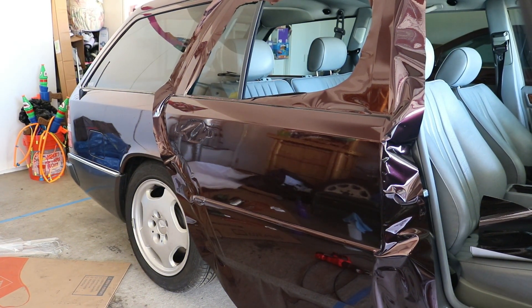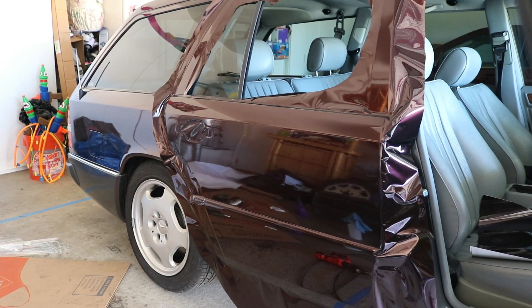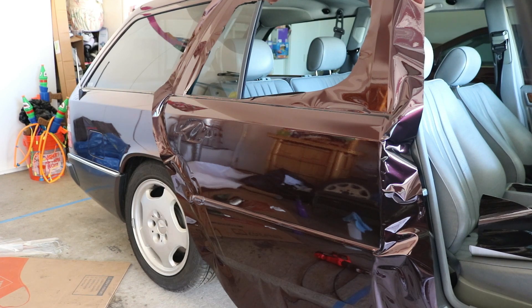I would say this door is 100% better than it was. I don't know what I was doing earlier, but it's fixed now, and I actually got the wrap on a lot faster than usual. I tried a different approach — it's way easier to just cut a rectangle and lay it on the car that way, so you can pull it left and right and squeegee it down and it looks a lot better. I'm going to trim off the excess and wrap around the corners and we'll be done with that door. I'm going to have to pull the car back outside to sand the roof.